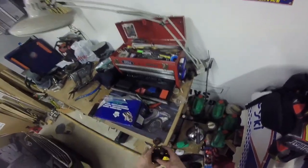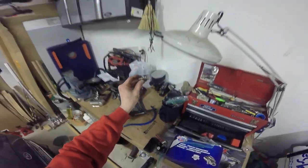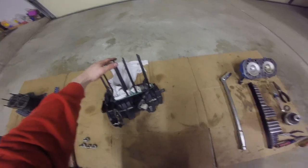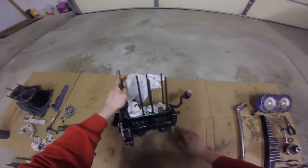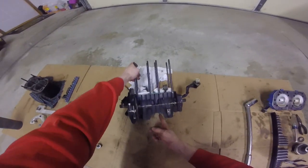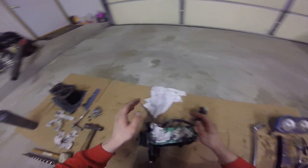If you watched one of the other videos where I took it out — one of them was completely out, which was this one. So if you have these Roz poly mounts, when you put this thing back together, they are good mounts and very durable compared to the stock ones, but that comes with an added amount of vibration. So what I'm going to do is instead of blue Loctite, I'm putting red on those, and I'm probably just going to put red on the bed plate just to make sure those don't come loose again.